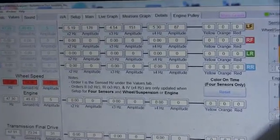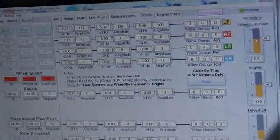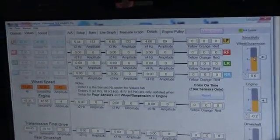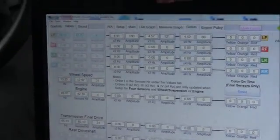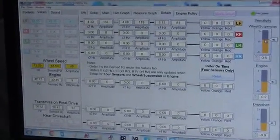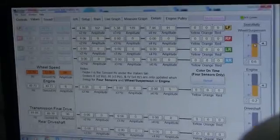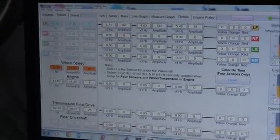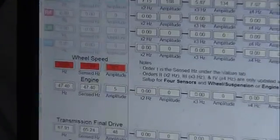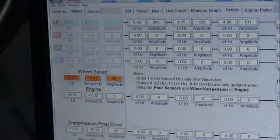So I'm going to back out of the throttle here, and it's barely vibrating. It's not very bad. This is load sensitive. I can see that right away. So I'm floating the car right now, at just a constant light throttle, and I can feel the vibration, but it's light. Now if I start to get into the throttle, okay, I can definitely feel it. So this has something to do with load. Where I'm loading it, I'm feeling it.